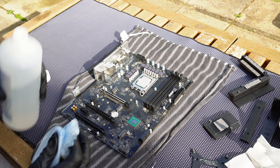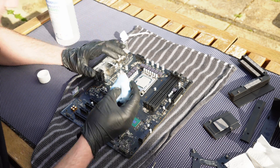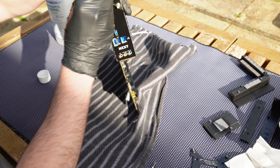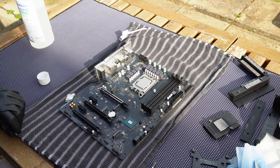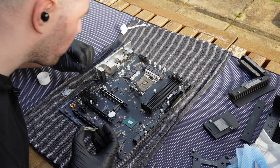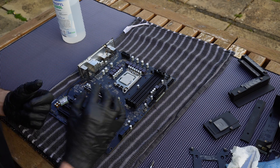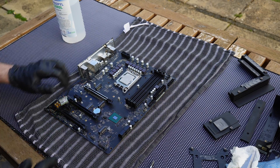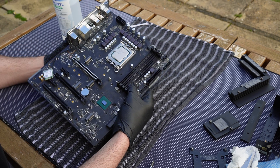This is all completely fine. I could get an ultrasonic cleaner for this, but I think IPA will be fine. Let's get some of the crap off the back plate - a little bit of either rust or fluid there. Looking at the CPU socket, there are no bent pins whatsoever - it's all pristine, no liquid in there. To protect the socket, I'm just going to put the CPU straight back in. Because we've used isopropyl alcohol, it dries a lot quicker, so you don't have to leave it as long as you would with plain water.